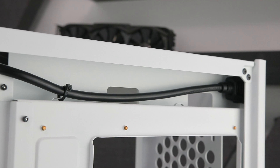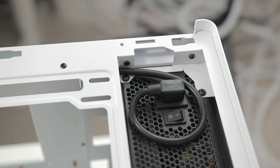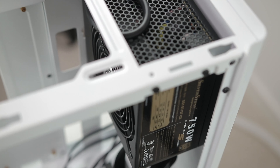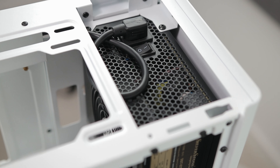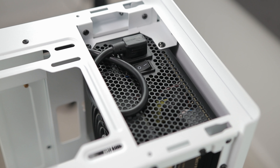The pass-through cable from the rear through to the front gives you enough slack for PSUs with the socket mounted to either side. You could mount it fan-side forward, but I'd suggest mounting it fan-side backward to make the airflow path a little easier towards the top of the case and keep the PSU a touch cooler. PSU fans don't spin very fast in most scenarios, so it's nigh on impossible that you'll starve your CPU cooler of airflow.